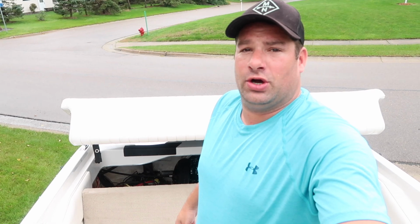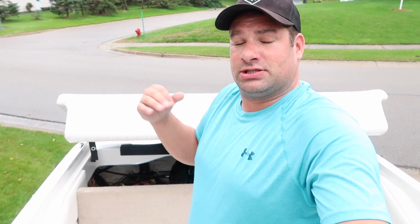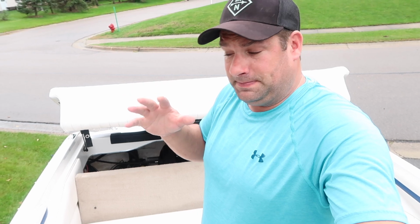So I did a video specifically showing you where the blue drain plugs are on this motor. On my 3.0, there were brass plugs. I have a video for that specifically also. I'll try to leave some of these links in the description. But what you want to do after you run it is you pull the blue plugs. There's 5 on this 4.3. Drain the block and the manifolds.